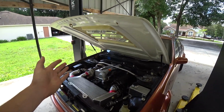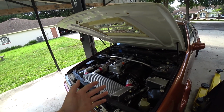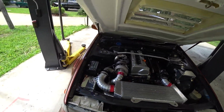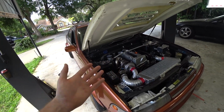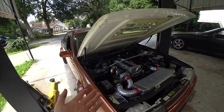I mean, it's running good up until the point where it just ignition cuts at around 10 PSI. So really unclear on what's going on there. Stu's gonna look through the base map to see if there was anything amiss. We are getting a trigger error randomly. I don't know if that's it. It's kind of weird that we're getting that error to begin with.